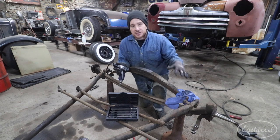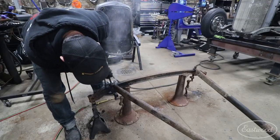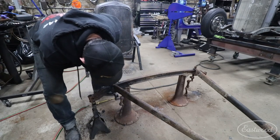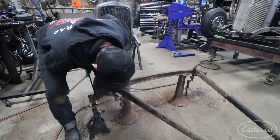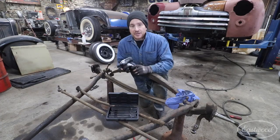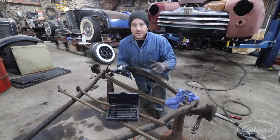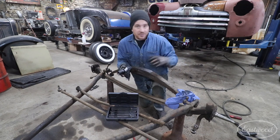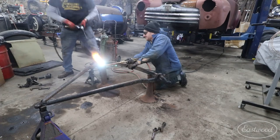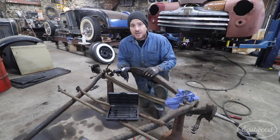I use this all the time for suspension parts — knocking apart these early Ford front straight axles — because a lot of the fasteners are a tight tolerance fit, and if they get any corrosion whatsoever in them, they are nearly impossible to get out. By using the Air Hammer Drift Pin Set, I'm able to knock pretty much all of these out. Any that are a little difficult, we just add a little bit of heat, and it will knock right out of the suspension. It really makes a difficult job a lot quicker.